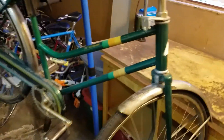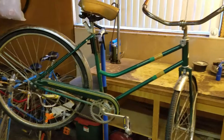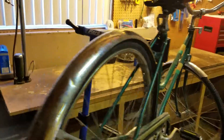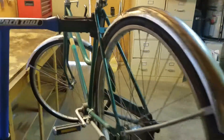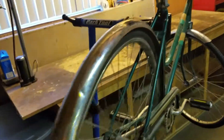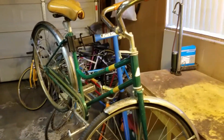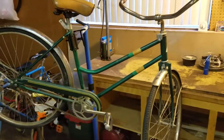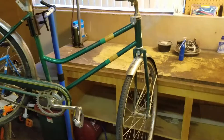It's a decent bike. What I want to do is — I have taken that hub apart, did my homework and looked into it. Basically, oftentimes you take them apart, clean everything up, re-grease it, put it back together again, and they work. But going back to my first statement: metal against metal. Who knows when the last time this bicycle had been serviced. I think the plates are just worn out. For my purposes, I don't really see it as feasible to go on eBay or wherever and try to find replacement parts. What would be feasible — and maybe more aesthetically pleasing and a little safer — is to try and put on some rim brakes.